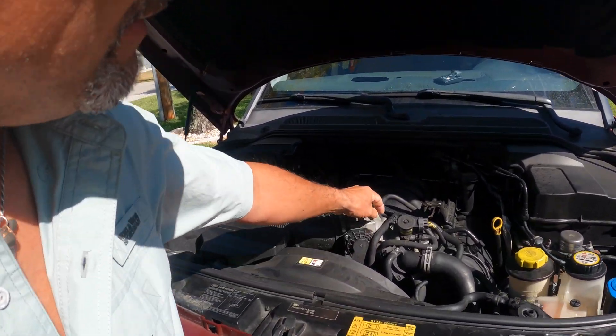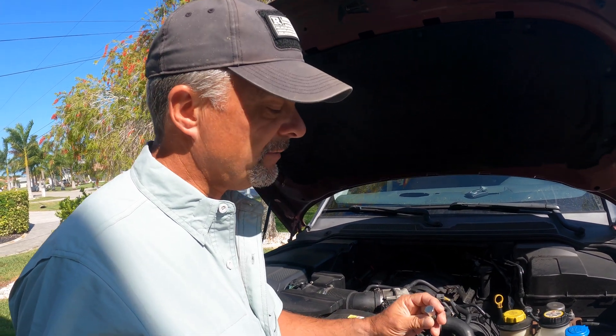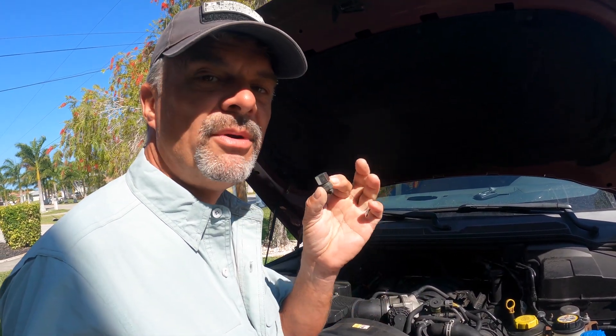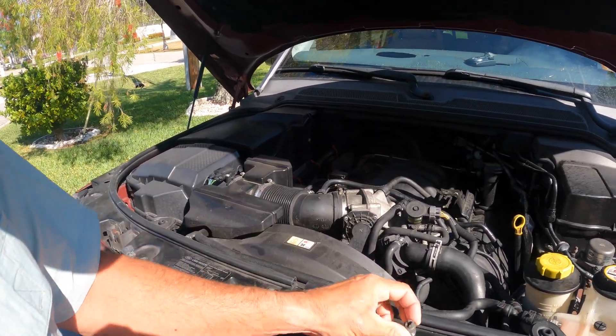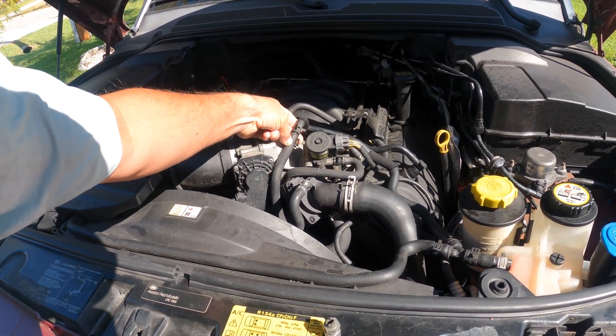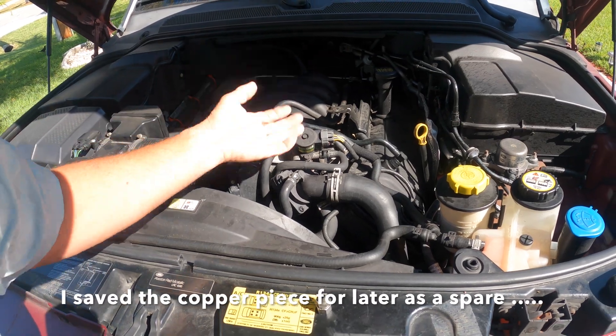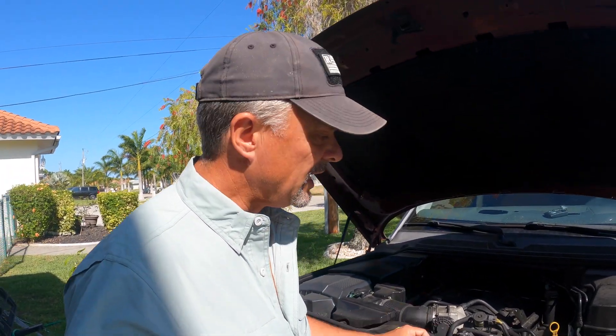If you have one of those on your Land Rover and it's more than 10 years old, I highly recommend you buy one — it's only $14 on Amazon and I'll put the link in the description. It takes a split second to take the two hoses apart, just two hose clamps. This broke while we were driving and it could have cost the head gaskets too if I'd kept running out of coolant. I ordered the part and will put it in in a few days.